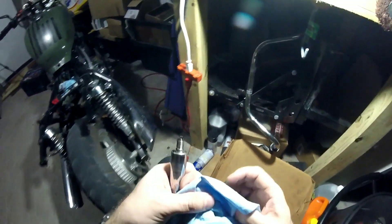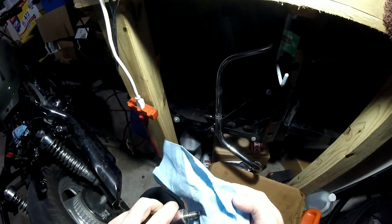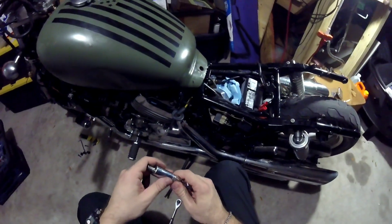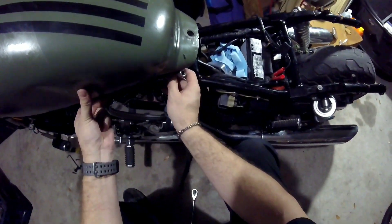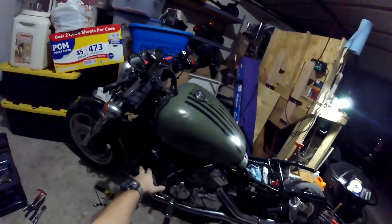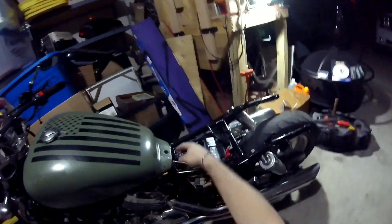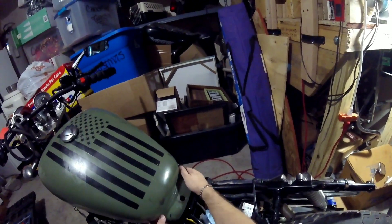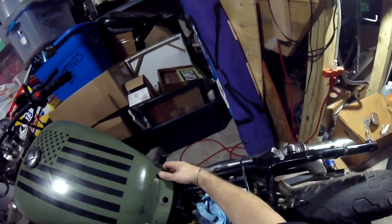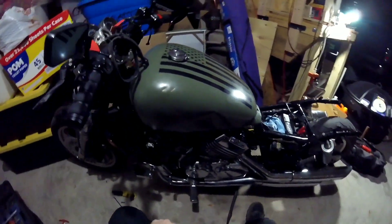This next one here — see, this one's dry. This is not very rich. That's good. Now I've checked all the gaps. The front cylinders look like they're running rich — those three were kind of rich — but this one in the back was not, which I'm okay with. We're going to see what happens.